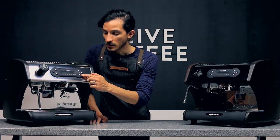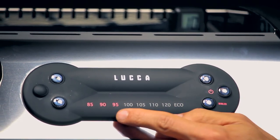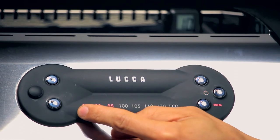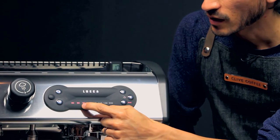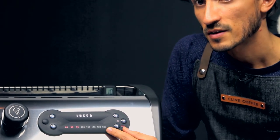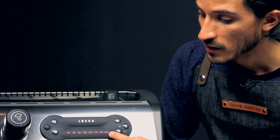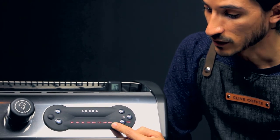Press and hold the B boiler button until you see the number lights. These will be lit if you have a setting already in there, or completely blank if pre-infusion is turned off. Each of these number steps all the way up to your eco light indicates one second of pre-infusion. You can cycle up to the maximum of eight seconds of pre-infusion.